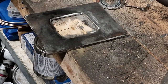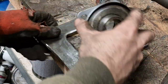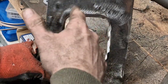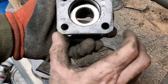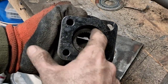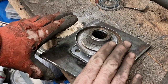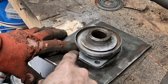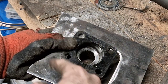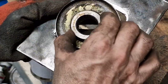Here's our plate — we have a kind of chamfer on the inside and outside, surfaces cleaned out, and this should fit here now. It does. If you look closely you can see that this is not a rectangle in any way at all — it's like these parts are just being chopped off a length of flat bar and the bore and the hole have been put on it, but the outsides have nothing to do with anything. It's only the holes that are important. So now I need to plant that down onto a plate, keep it all flat, run a weld around, and then we have a concentric result relative to that shaft bearing piece.